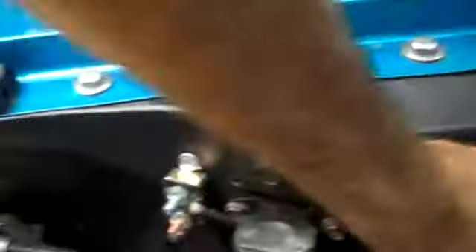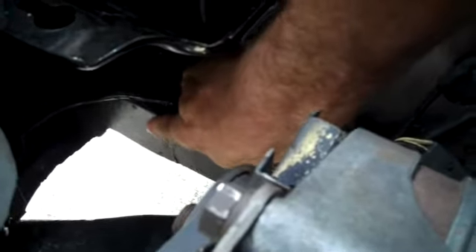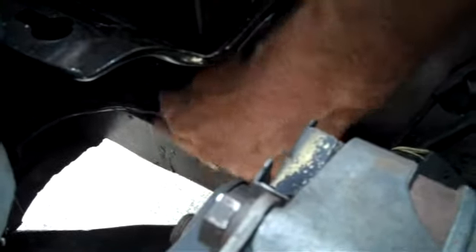The inner fender aprons are all the original steel. It's got a new battery tray, however there's some Bondo just there where they've sort of smoothed it in for a repair underneath it — I'll show you in a second. There is also way down on this front rail where it comes in, it's got a smear of smoothness to it that I didn't really like. And that's normally a common spot for them to get some form of rust, or a hole, one of the two.